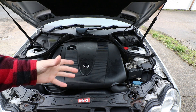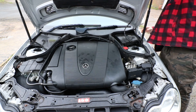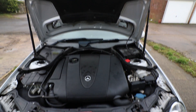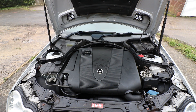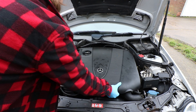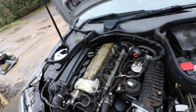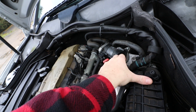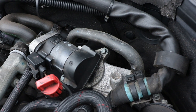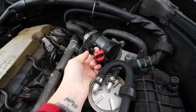I'm going to show you where the EGR is, how to remove it, and what you can do when you're there. On these Mercs, a really good thing is you can put the bonnet into service mode — it puts it directly up, giving you way more access. Next, just take the engine cover off; it's the type that lifts off on captive tabs. Looking at the engine, the EGR is top right.